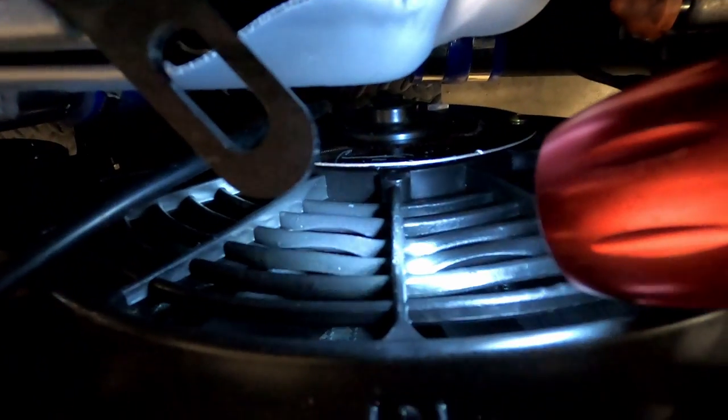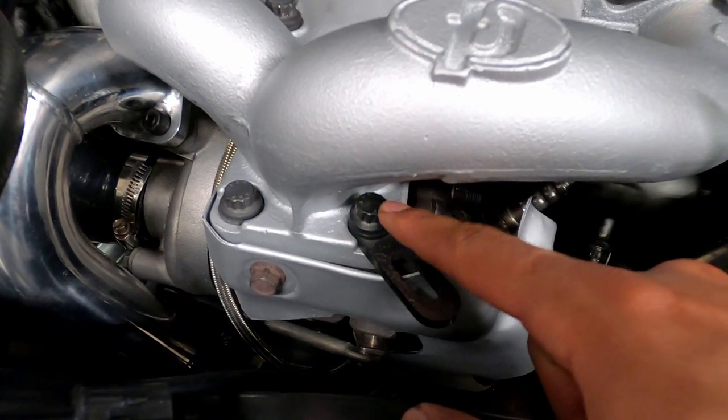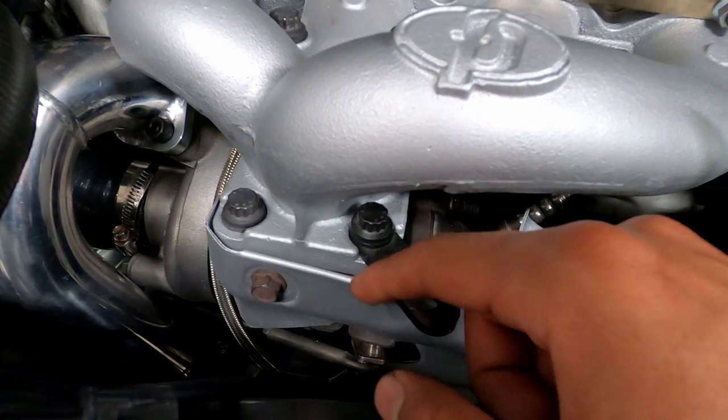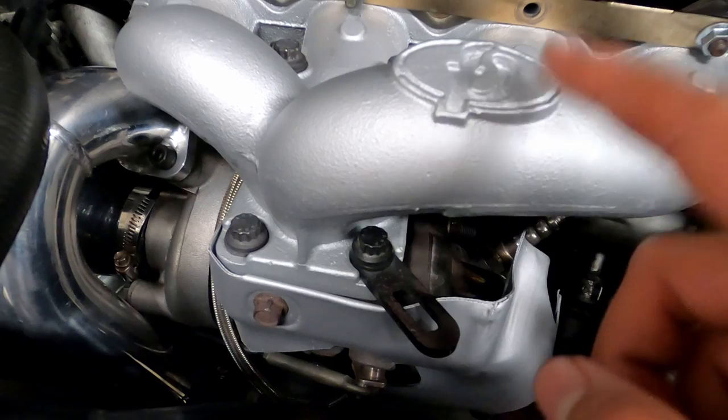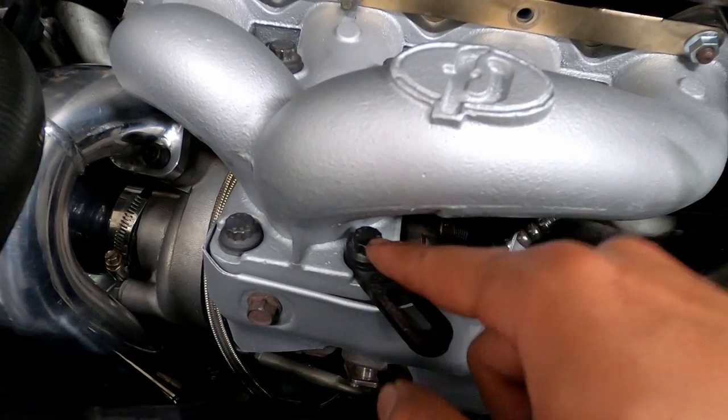The fan started to melt a little. I think it's because this bolt right here is really hard to tighten — there's barely any space. So what I did when I took this off was grind it down a little so I could fit a 12mm socket in there.